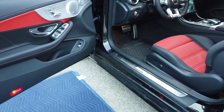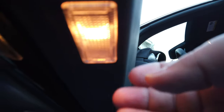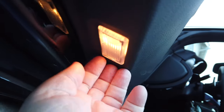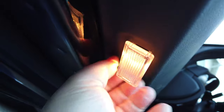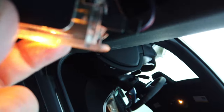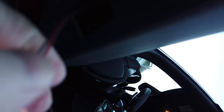We're going to go ahead and do the driver's side now and have this project wrapped up pretty quick. Got this other light on the driver's side to pull out. I want to show you guys how to pull them out - basically you just stick your fingernails under and carefully work the light down. There's a plug on the side towards the rear of the car, so if you can pop the front down you'll be able to pull it out. You'll see it's just plastic teeth on each end - those little plastic teeth are what hold it into place.